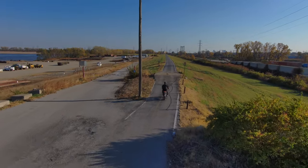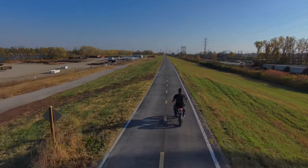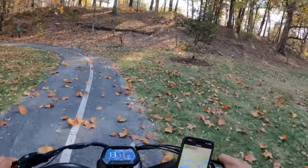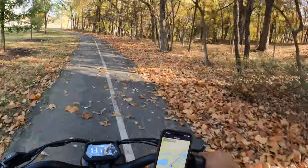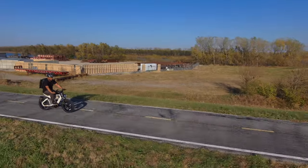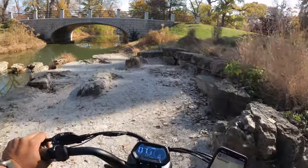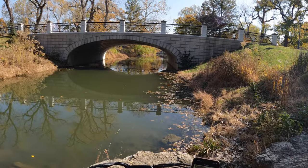This bike has a Samsung 1040 watt-hour battery inside it. The company estimates you can get between 32 and 78 miles — 32 miles is throttle only, and up to 78 miles is pedal assist level 1. The higher the pedal assist level you use, the more the motor helps and the less range you get. From my experience riding this bike for a few weeks, the range is pretty spot on. I weigh around 220 pounds and this bike supports up to 360 pounds; the bike itself weighs 99 pounds.